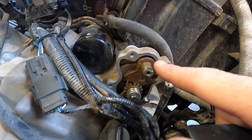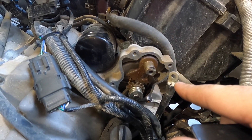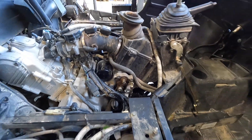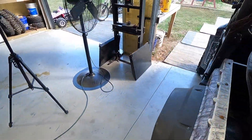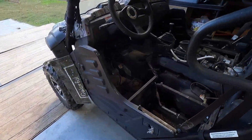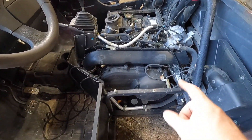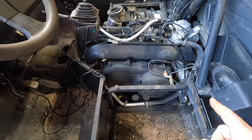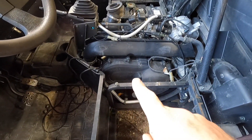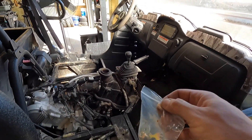I've already done this off camera - shifted it and nothing happens. He said to replace the wet clutch and the one-way bearing, so I'm thinking he got the one-way bearing installed backwards most likely. We're going to fix the clutches and then pull the cover off, check the primary, make sure it spins the proper direction, check the one-way bearing, drain his oil, and see what's going on with the wet clutch.